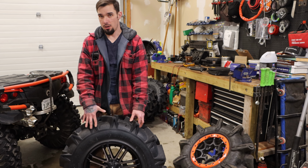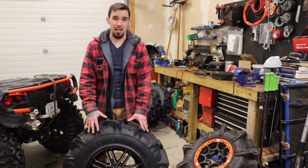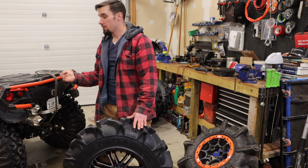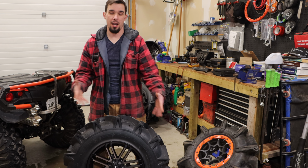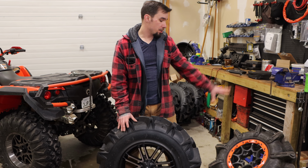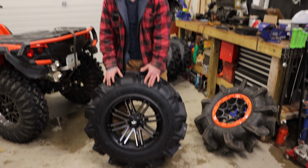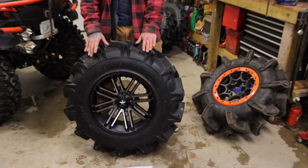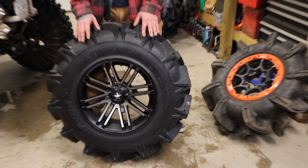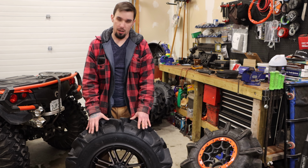It's a 32 tall, 8.5 wide, so they're technically like pizza cutters, they're skinnier, which actually is fantastic for my current predicament. The width on the tire actually creates a lot of the fitment issues, so we are going from those Assassinators to these MotoHavocs being the current tire for me. The one thing I'm definitely going to lose out on is flotation. The Assassinators with their width and paddle make quite good tires in the water. These tires I think will do fine.